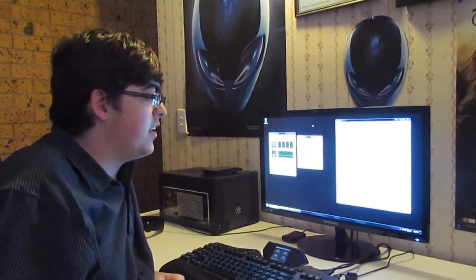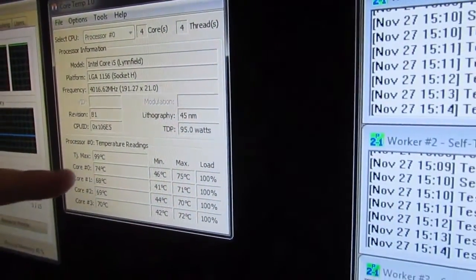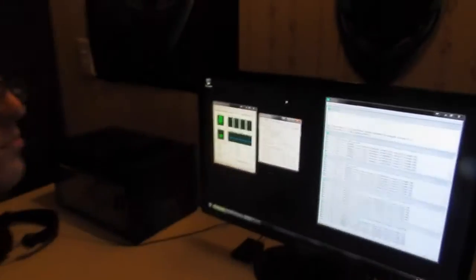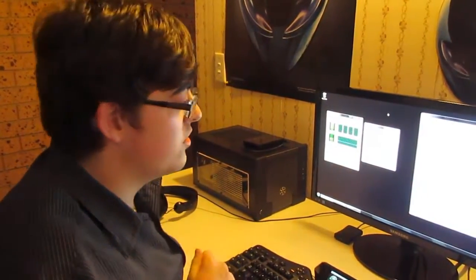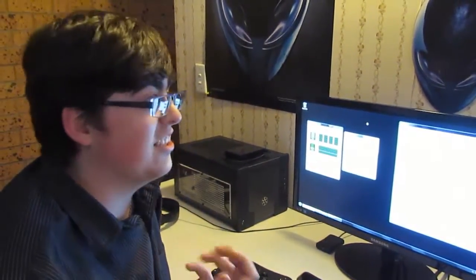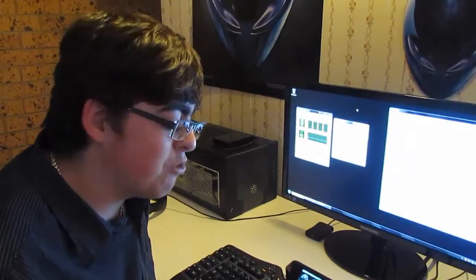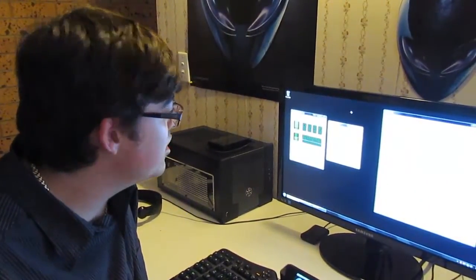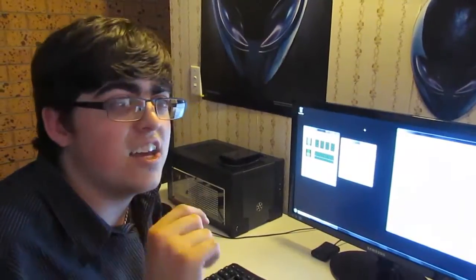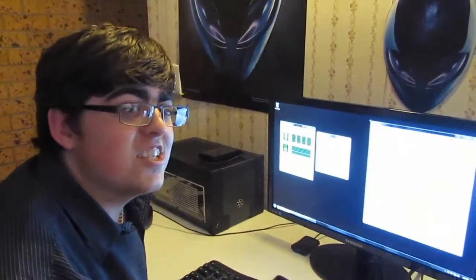We're back after about half an hour and we can still see our Prime95 workers running. Looking at current temperatures, the first core managed to get about 75 degrees. So it's pretty much a 10 to 15 degree difference between air cooling and water cooling. We'll notice more of a difference in cooler weather, as it is quite hot today both outside and inside. It definitely still manages to show quite a difference between air and water cooling. This was a pretty good experiment. Thanks for watching — we now have a Facebook page at facebook.com/jacobspcstuff, link in the description. Thanks for watching and see you next time.